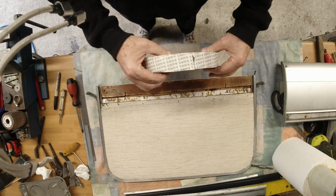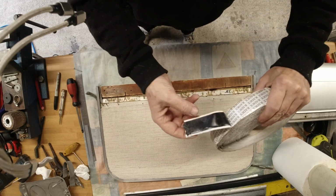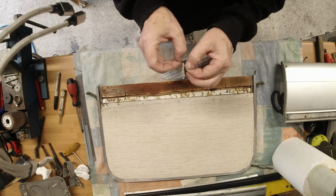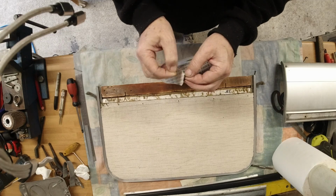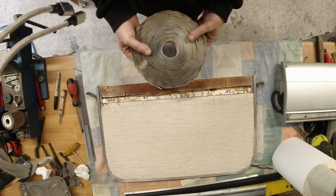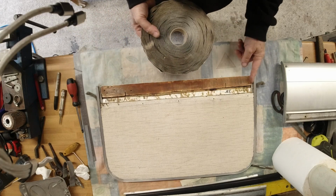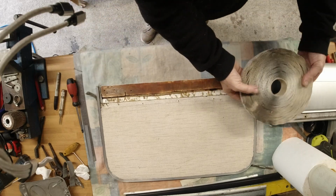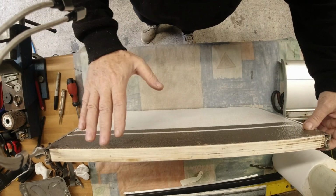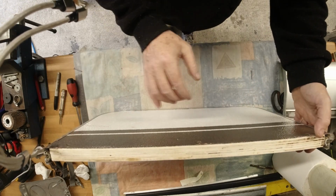This is another product, Radex. This is a really good product. It's like for a radon barrier, or if you're joining that black sheeting. So you can just put this on and peel off this side, and it's obviously waterproof, right? And it's sticky. And I'm thinking of putting a piece, if I can get it in there and along the bottom. In practical terms, that would completely seal all this wood from the elements and getting wet. Okay, so it would be sealed.